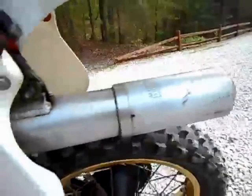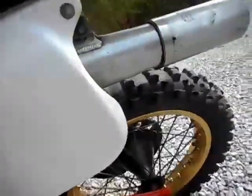It's got one dent right there. Other than that, it goes all the way back to the stock silencer, which is nice. I'm running 32 to 1 mix on this bike, so it's a little fat. Got a little oil splatter here and there on the wheels and various places, but you can cut it down and run it a little thinner — I just like running them fat.